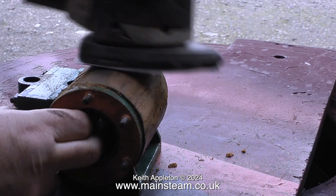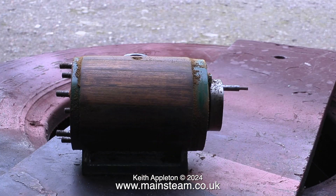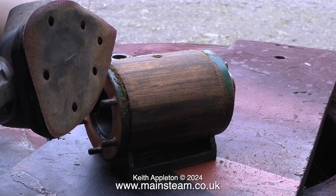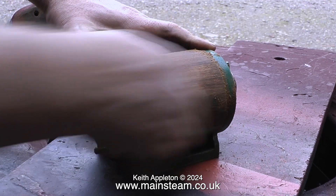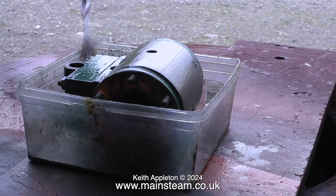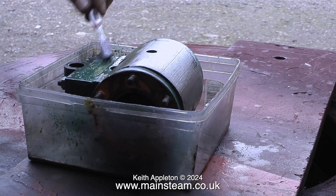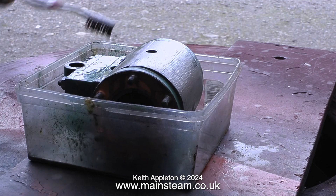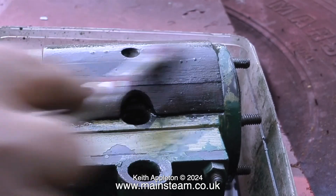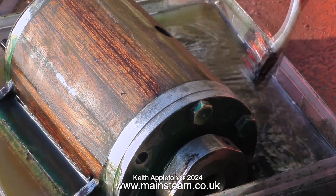The engine was in a bit of a state so I started the cosmetic renovation at the same time. I chose to rub down the cylinder with the new liner in place, because if it works loose it's not a success. The good news is it didn't work loose at all — despite being heavily vibrated with an orbital sander, sat in a tub with cellulose thinners, and being drenched in cellulose thinners during the paint removal process. At no time did the liner move, so I'm really quite confident this is going to work.